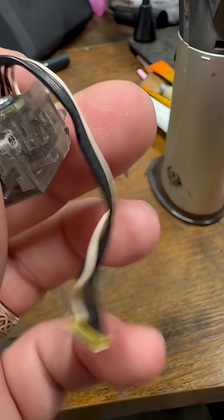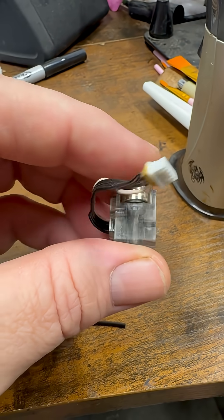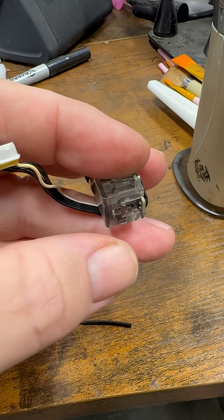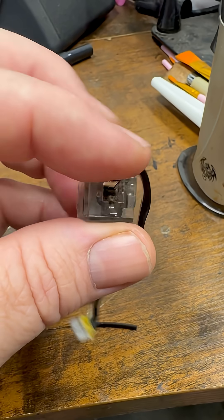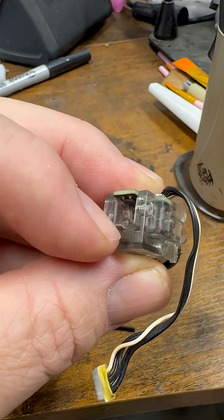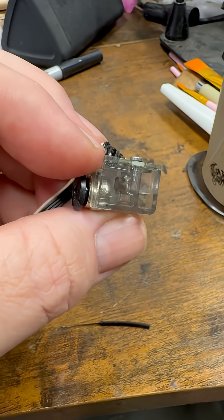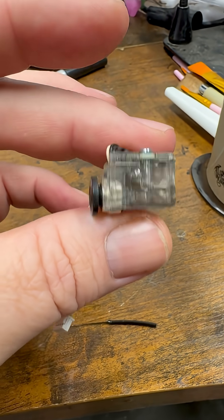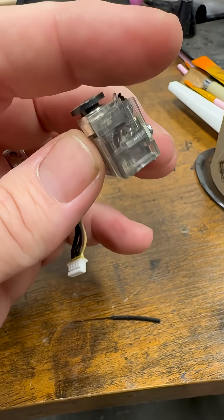This is the sensor I'm talking about, and it's at the top of the extruder. What you want to look out for is if that broken piece is just under this sensor or still stuck in it, because it has a little metal tab right here which lets the printer know that there's something still inside the extruder. So if you've exhausted all options and can't figure out why it won't feed through the AMS and it keeps saying there's stuff in there, that is your culprit.